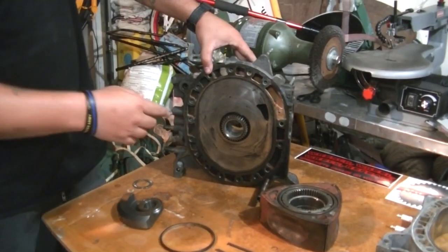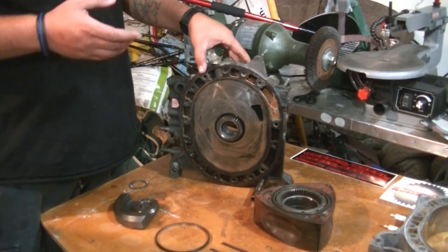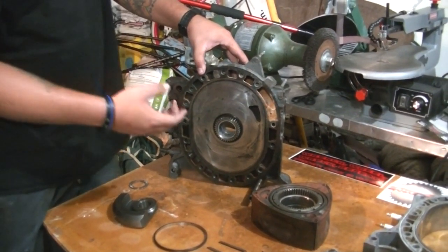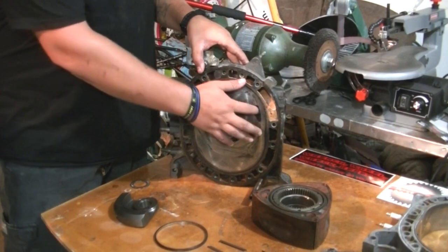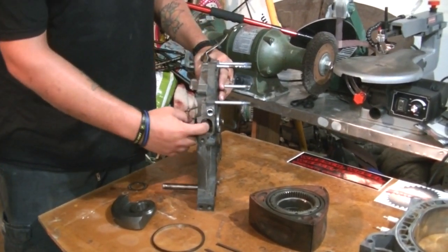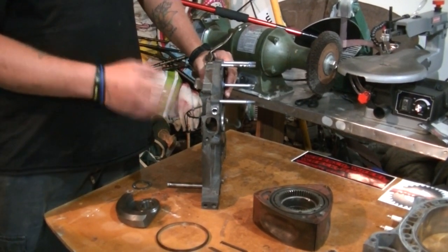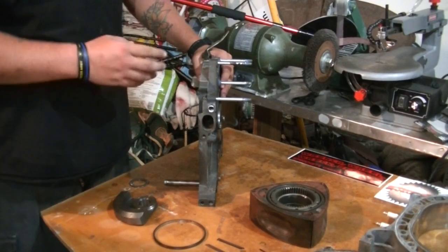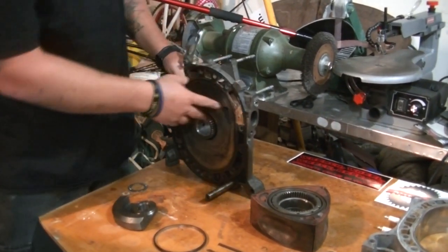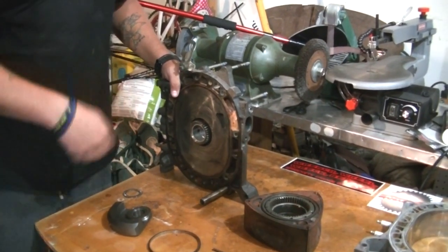One thing I want to point out, everybody's very familiar with cams and valves. A rotary engine lacks that, simply because of the design and the port. This is an intake port, simply pulling from the intake manifold, which bolts up directly here. These ports can be played with in many different ways, sizes, shapes, so on and so forth. Anything from the stock port that Mazda put into these, all the way up to what we call a peripheral port. Peripheral port's getting way off into the distance on things. I don't want to confuse y'all, so we're going to stick to the basics.